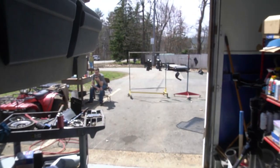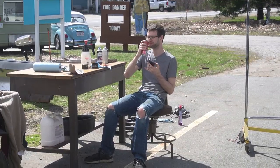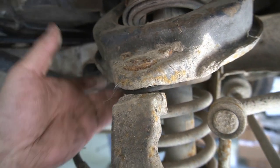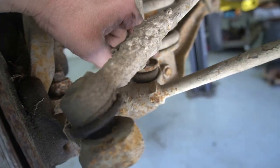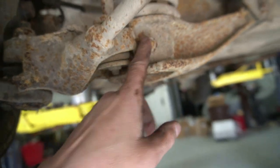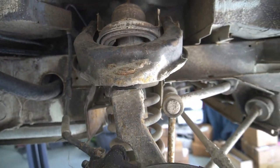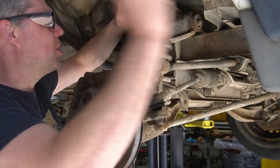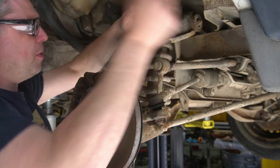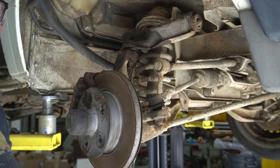Sorry about the noise — I have the door open, it's beautiful outside. Kev's out there enjoying his lunch. We have to take out the ball joint — these two bolts come out, we'll lube that up and give it about an hour to soak. We've got to take out the sway bar link here as well, and then this will swing out of the way. Then we got the bolt that holds the shock, and one up here that probably doesn't want to move either. These bolts are pretty rusty but they're coming out — I had to really jam that in there. It's all like one part now.